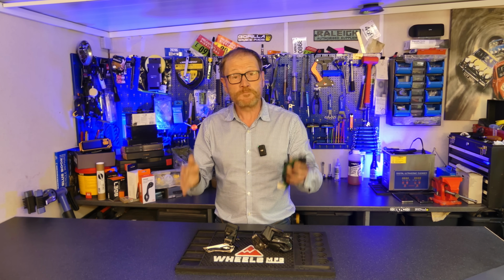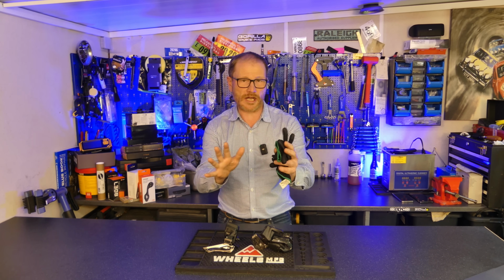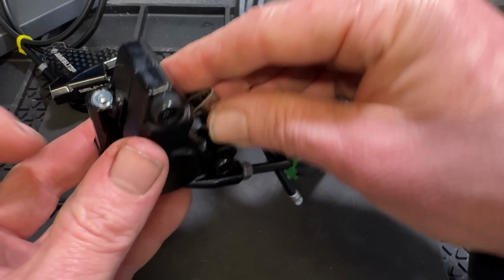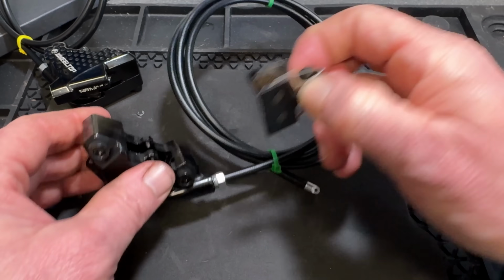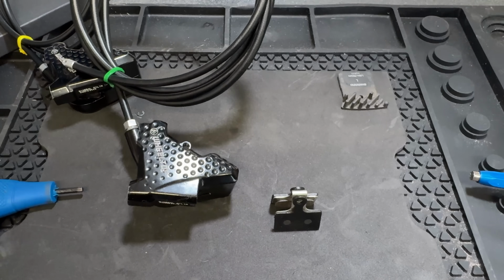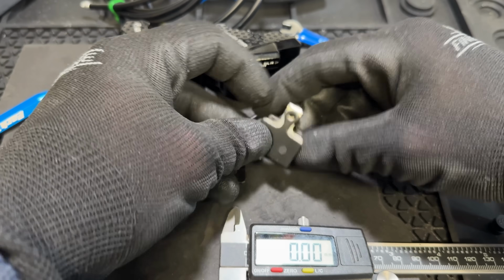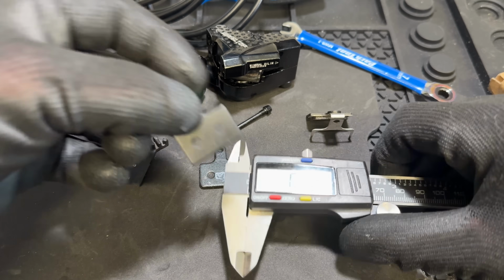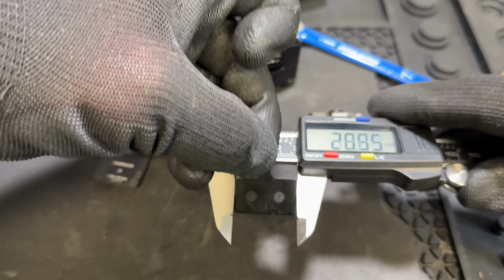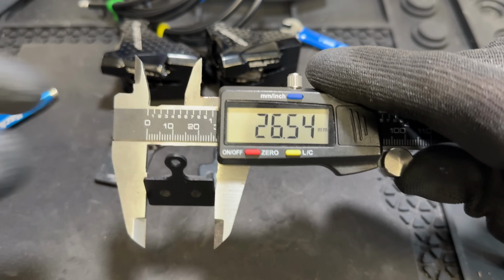The pads, on the other hand, that come with the Wheeltop calipers, that's a different story. They do make that I'm eating your rotors sound every time you apply the brakes. Now, as I was testing the whole Groupset, I had to continue using those. But if I was to fit a new Wheeltop Groupset now to one of my bikes, I wouldn't use those pads and I would use either the Shimano Road finned or non-finned pad, which both fit into that Wheeltop caliper.